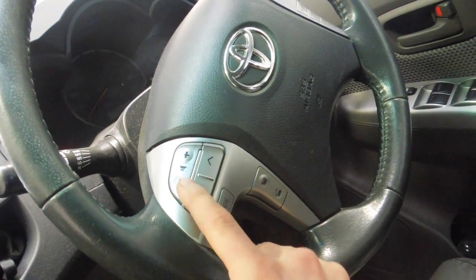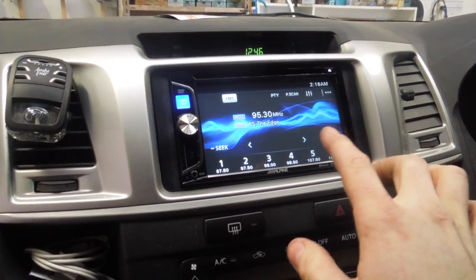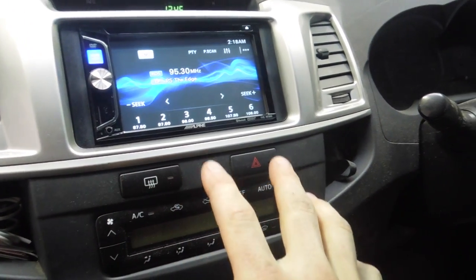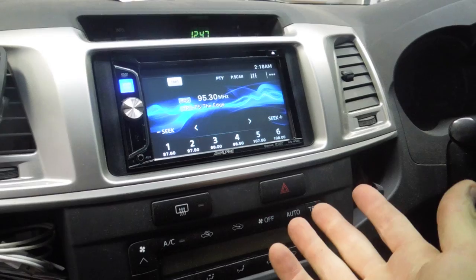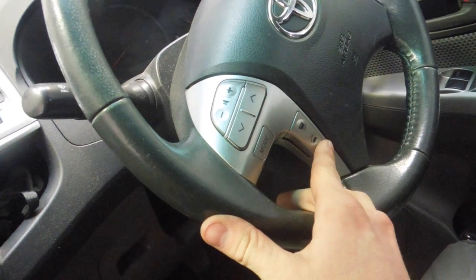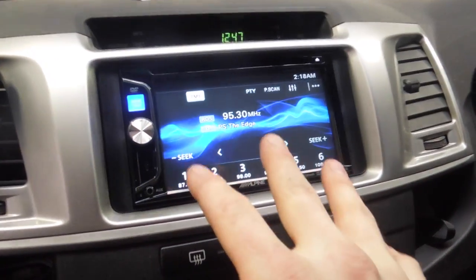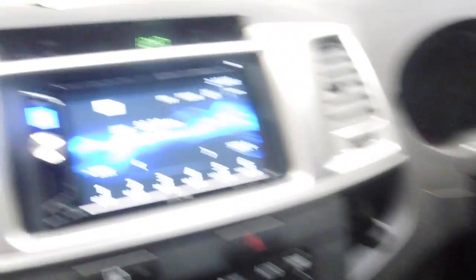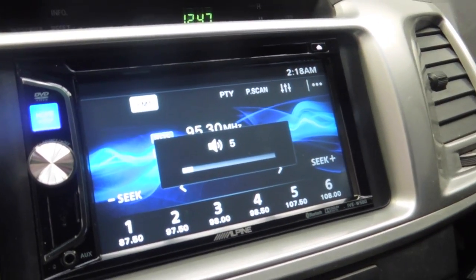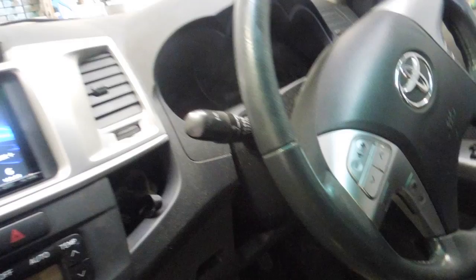On this Hilux it does have some phone buttons down here. That is one downside to the built-in decoder — there aren't a whole lot of options as to what you can program the stereo to do. If you were to use an external decoder, you can program pretty much anything. But using the internal one, it doesn't have functions for phone buttons. So what I did instead was program these two buttons here — the pick-up and hang-up buttons — to the last two available functions, which were mute and play/pause. So if I push this one here, it mutes it, and this one acts as a play/pause button. But he's got his source button, his volume button, and his seek buttons, and that's all you really need.